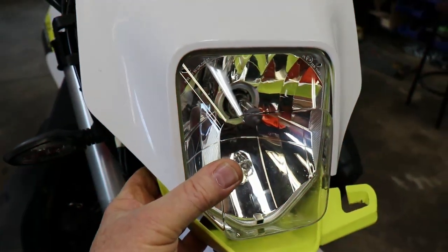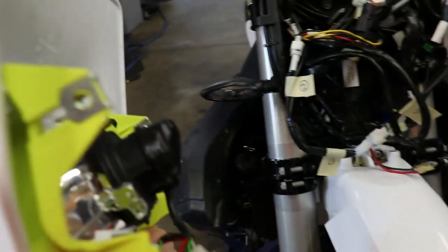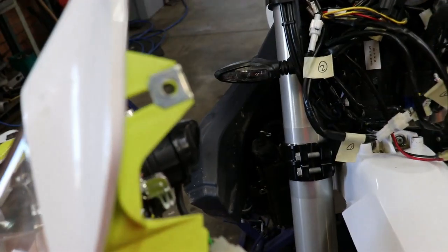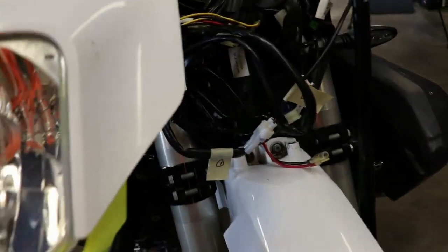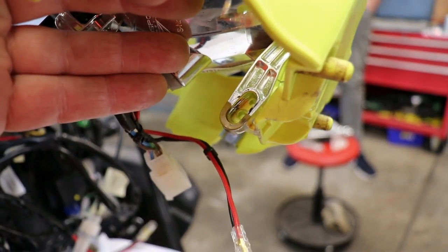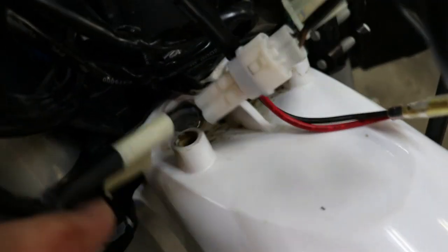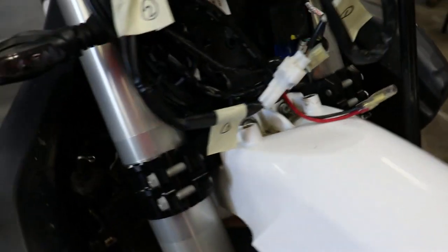Okay, so we've removed the headlight. As you can see, there's a bolt position on both sides. Once again, the same, it's an 8mm hex, but it has a Torx centre to it. Then underneath, you can see in there, there's another little bolt in there. Actually, I probably didn't need to remove that, but I did. Anyway, that's off. And there's two positions to locating tags there, and they drop down into the top of that mudguard there.